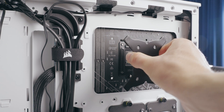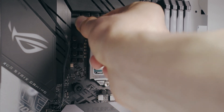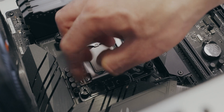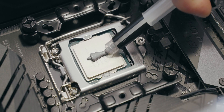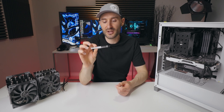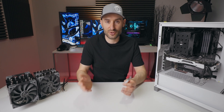Installing on Intel 115X starts with the back plate that fits behind the CPU socket on the motherboard. Four plastic spacers slide down against the motherboard — no tools required. Mounting brackets drop onto the posts and sit on top of the spacers, one for each side of the CPU socket, and then four bolt nuts get threaded on and torqued down with the included screwdriver. The cooler doesn't ship with pre-applied thermal paste, so you apply it yourself using the included tube. I've tested Scythe's paste against Arctic Silver 5 and found temperatures to be almost identical, so you can feel confident using what comes in the box.